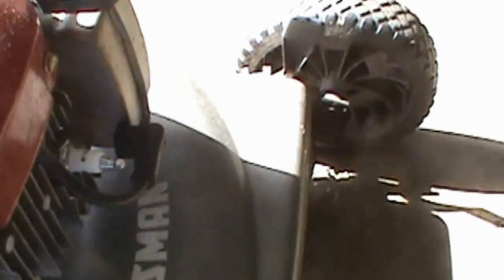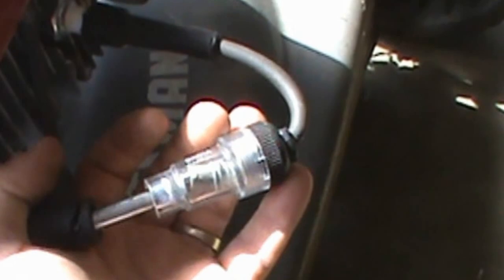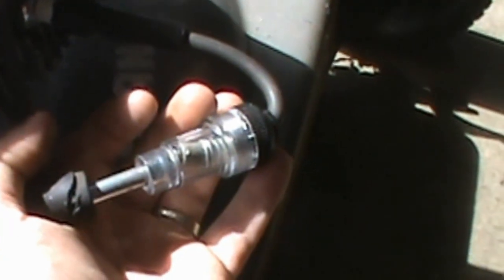You can check for spark by looking at the spark plug, and you can put a spark tester on the spark plug right here — kind of like this. This is what I use; it lights up. I just plug it into the spark plug just like that, and once it's plugged in I hook it up to the coil by attaching it to the end like this. Then pull the starter and see if it lights up — that's a real easy way to test for spark.